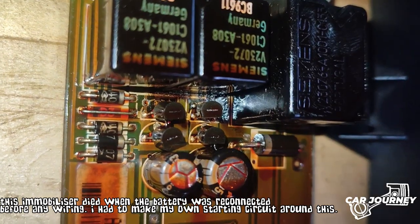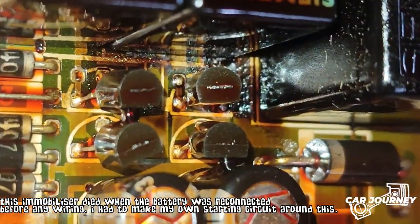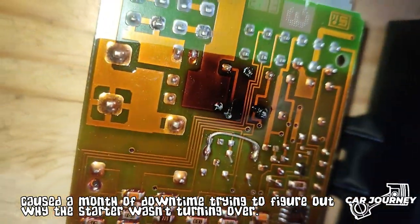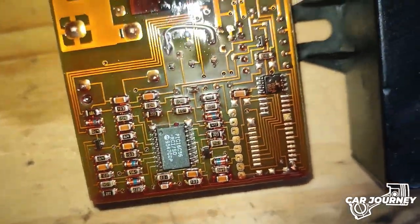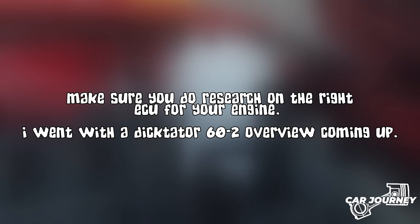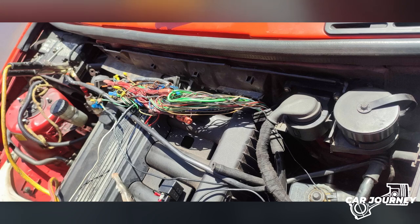With the hardware mostly installed, you should decide on which wiring harness and ECU to use. I went with standalone engine management, which I'll cover in another video. The Bosch wiring harness doesn't have the O2 sensor and ends with an ECU with serial number 413 at the end, whereas the Siemens ECU makes use of O2 sensors to accurately measure the air-fuel ratio. If you installed an engine with a wiring harness, do your wire management while you still have the time. Make sure to put the E30 coolant sensor in the cylinder head — the brown single-pin unit — which you'll need for instrument cluster feedback.